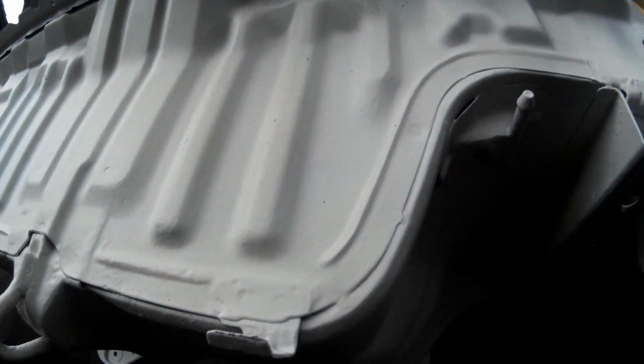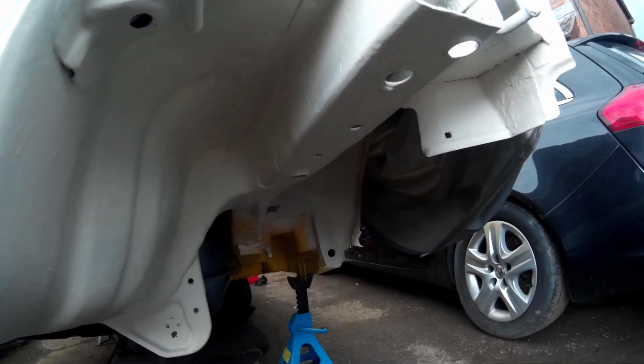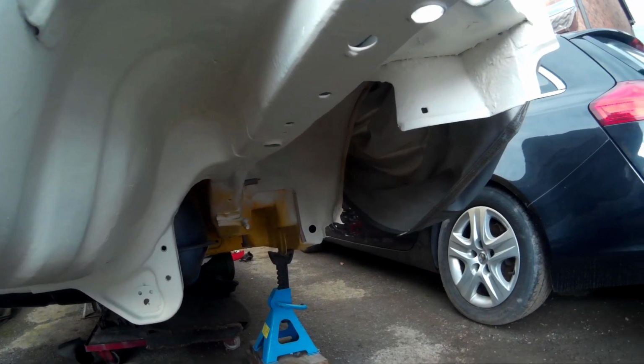You may not have seen, but I took the tyres out and put them on axle stands, finished that one arch off, and I've got to all the back bay like I said I was going to do. Sealed all that, flattened it all back, got all the underseal off, sealed it. And I'll seal the bit of the arch which needed to be finished.